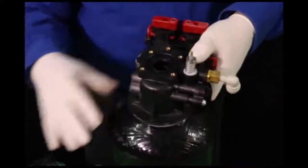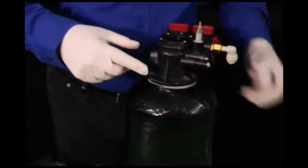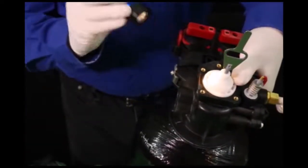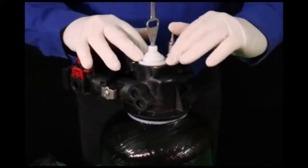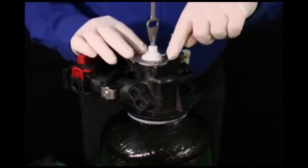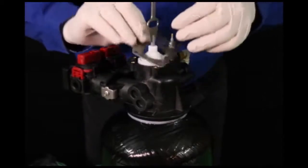Get this turned around so you can see a little better. It's difficult to see, but it looks like it's too high. When you put the piston back in and slide it in, that looks like it's too high — it's supposed to look that way. I'll show you what's going to happen when we put this back down. Get everything back in place. You can only put this on one way — this goes where the brine valve is. This notch right here is where the timer will slip onto; it's keyed so the timer will slide back over this notch. If you put that in upside down, it's not going to work. It only goes on one way — you can't get it wrong.